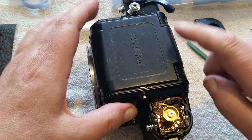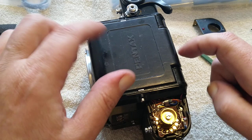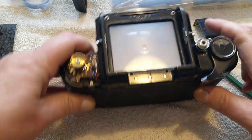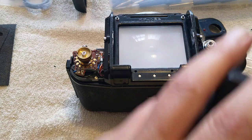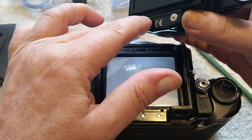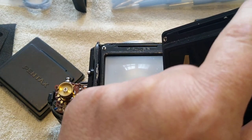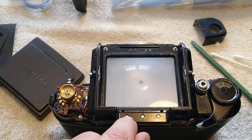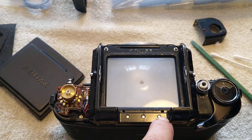The other issue I had with this camera is the metering prism. When I put the TTL prism on it wasn't getting any power. I know the prism was good, so it had a problem. The prisms connect to these cameras via some prongs on the base that connect to the back of here. Here's a metering prism — it has prongs on here, spring loaded, that connect to the camera body. But they also connect through these two at the front here.